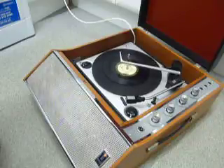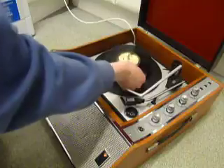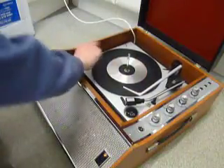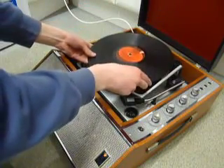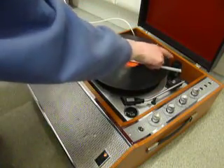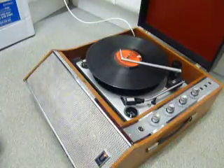I'll just demonstrate now with the start of a 12 inch record too. When you stack a 10 or 12 inch record, the black horizontal lever here is the size detection system. You need to make sure the record is stacked above the black lever like so, so that the tonearm knows to land in the correct position.